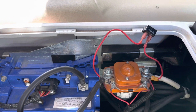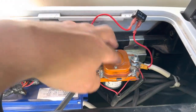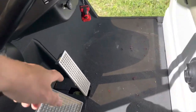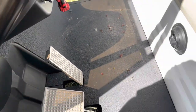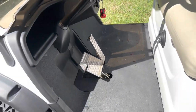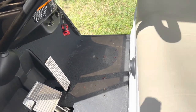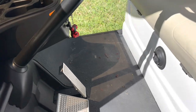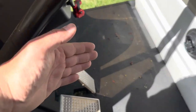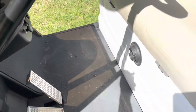The indicator light was blinking one green, two red - and that's low voltage. The batteries are charged, I got 51 volts here even when the pedal is depressed, so I knew something's going on with this coil. The software will actually tell you if the pedal is working or not. You can also enable and disable a speed sensor - speed sensors will cause this issue as well. I went in the software and was able to change it to a four-pole just in case, but that wasn't the issue. I was able to see RPMs, voltage, and pedal response zero to 100.